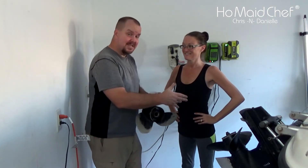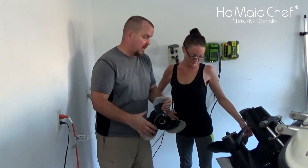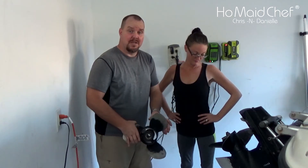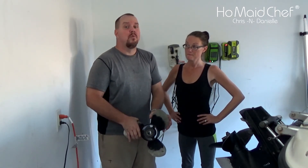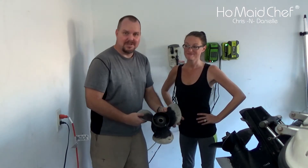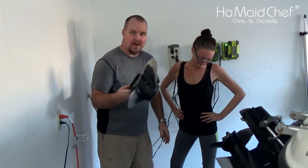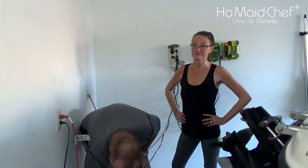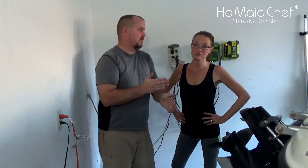Now they say you should do this like every year to make sure your prop can come off, re-grease it and things like that. Because this was actually the first time — didn't show this in the video — it was a bear to get off, beating it with a stick, clank clank clank, just loud. New prop's on this one. The previous owner probably blew the engine — that's why we got the boat for a thousand dollars.